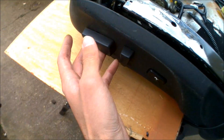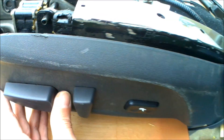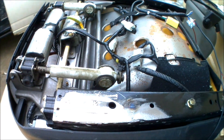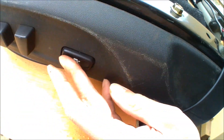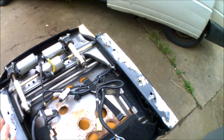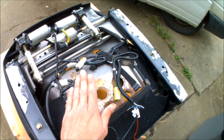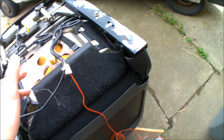Once connected to the battery it's okay to test the motors on the mechanism. On the seat it's a multi-function switch on the front — push it backwards and forwards and that moves the runners; up or down raises and lowers the height of the seat; that one moves the backrest; and that one's the lumbar support. All motors are working fine, lumbar support's working fine, so I'm going to presume the heated seat will be fine too. Worst case if the heated seat didn't work I'll just leave it off. Now I know everything works so it's okay to start drilling the holes in the seat runners.